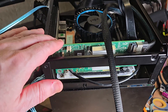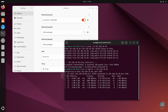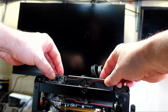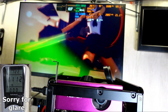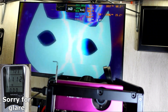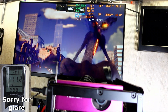To validate the PCIe slot through other means, I used an LSI SAS HBA adapter and an Intel 10GB network adapter — both were detected and performed without issues. I also installed an AMD Radeon RX 6400 and an RTX 3050 video card; neither requires external power and draws from the PCIe slot, which provides up to 75W. After running GPU benchmarks, both performed as expected, and the RTX 3050 drew over 70W without issue. So the PCIe slot itself is fine — the PCIe-to-M.2 adapter simply had compatibility issues.